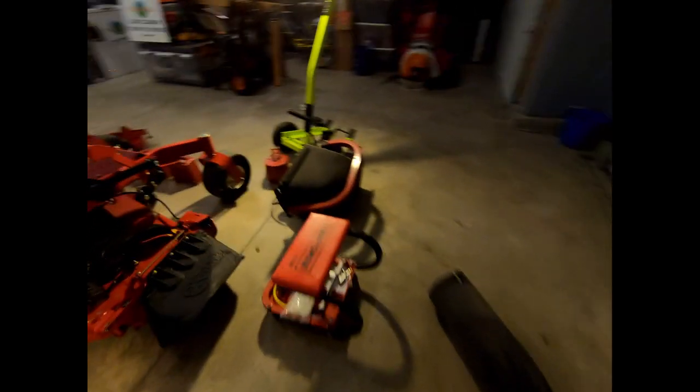Leaves have been falling out here and all around the country. I'm doing my first leaf cleanup of the season tomorrow. That's on there. I've got a 24 acre property that I service and leaves are falling. I'm installing — taking this arm off — I need to install this arm here onto the hopper. This is part of the Exmark quick dump control system. I pull up on this arm and this hopper opens up. I don't even have to get off the mower to dump my leaves.